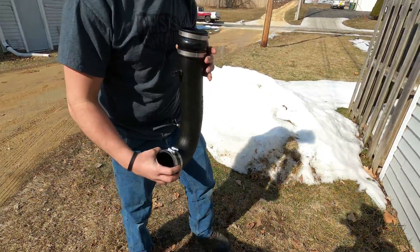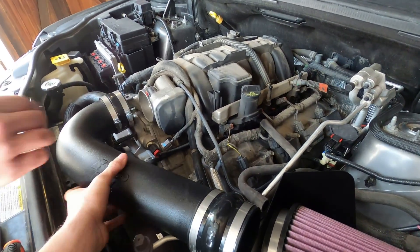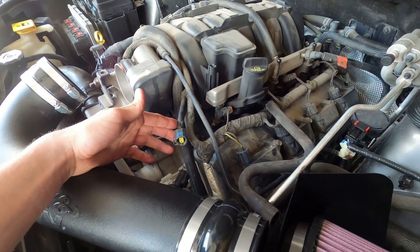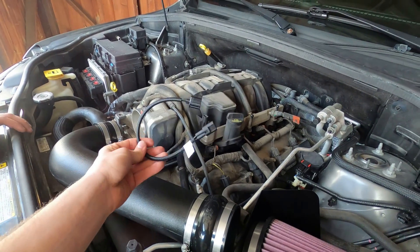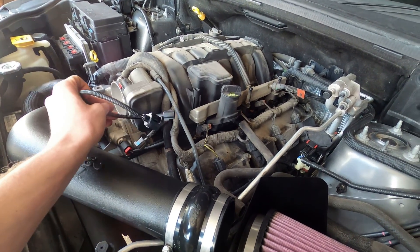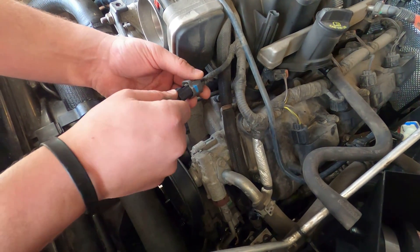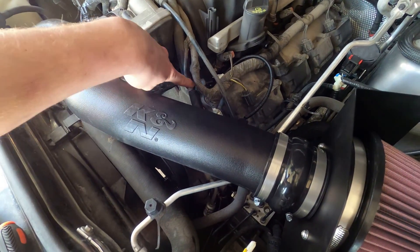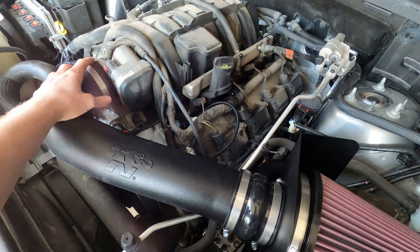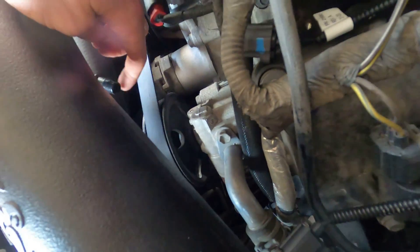Now we're ready to install the pipe. As you can see with this mocked up, here's your plug for your intake air temperature and here is the actual sensor — it's not long enough. So K&N actually thought of that and gave you an extended connector. All we'll do is plug the male side into this one and the female onto the sensor, and we'll be ready to install the tube. I hooked this around so now it looks factory — the engine cover will actually cover it. That factory hose is garbage, so we're going to use the hose that K&N provided, going from here all the way down to this nipple.